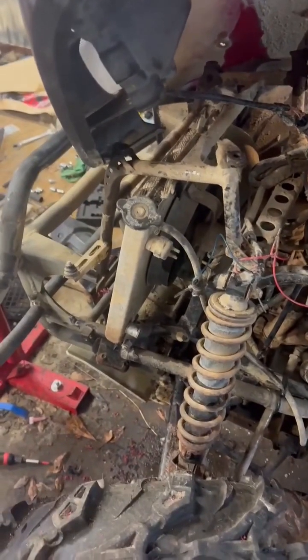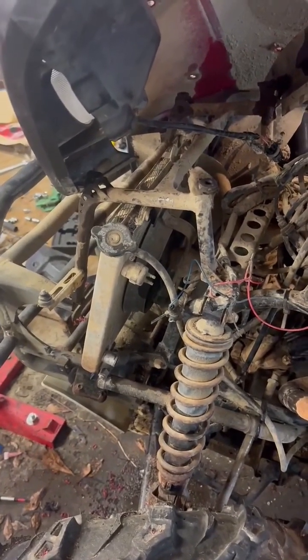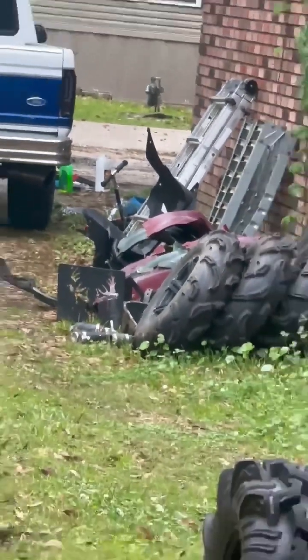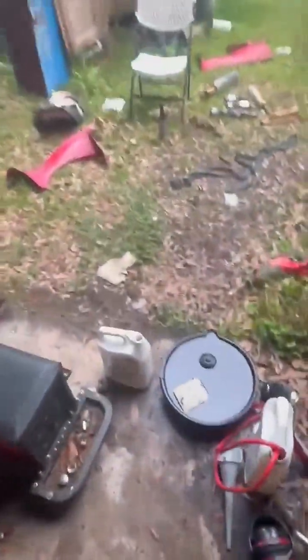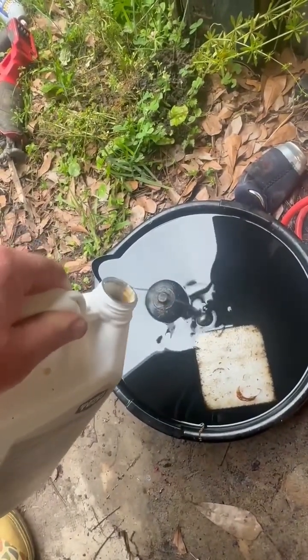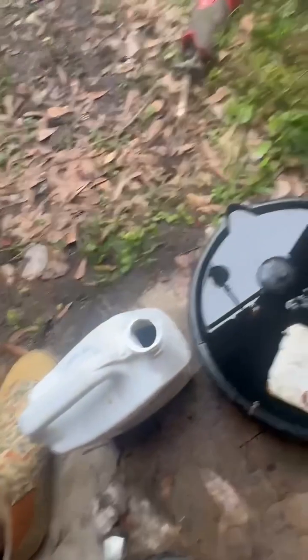So I was like, well, I got a few days. Let me pull this radiator out, even though it's got brand new coolant in it, and go ahead and put this relocator that I got on. I think I paid $40 for all these plastics, floorboards, snorkel kit, everything. All right, so I drained the coolant, full of oil. Does anybody know what that might mean? I'm Googling mechanical seal. So yeah, what y'all think?